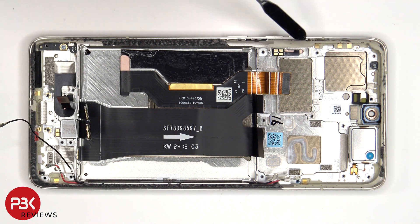When it comes to replacing the flex cable for the volume keys or power button, as per usual with Motorola, the flex cable is routed through an opening in the midframe, so you would actually have to pry the screen off as well. I don't know why they do that, but it definitely makes replacing that a headache, since there's a higher chance of damaging a working screen by prying it off.